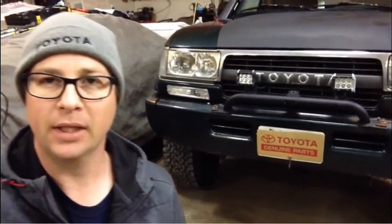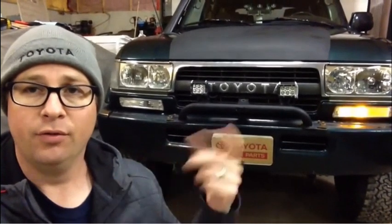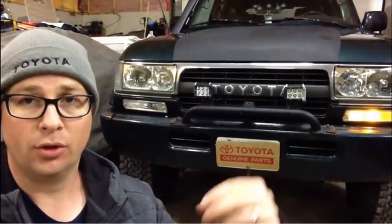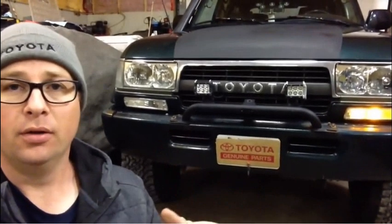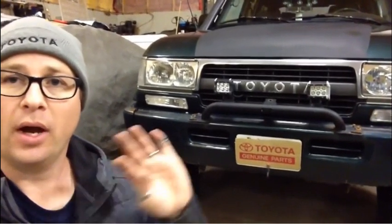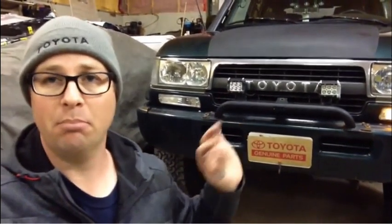So let me pop this light out. Now, before I pull the light assembly out, the reason I have this on my four ways is because I wanted to make sure it's not the signal switch. The turn signal switch and the four ways use the same flasher circuitry. This light is not working whether it's set to turn signal or hazard, so I can pretty much rule out the turn signal switch in the steering column. And the fact that the rear light is working helps me rule that out as well. So I'm taking an assumption that it's something in the front half of the truck, because the wiring going to the back is functioning.